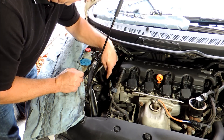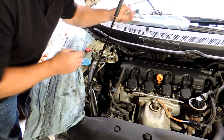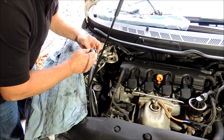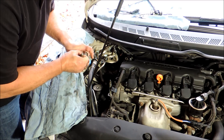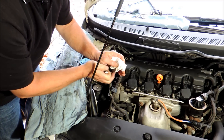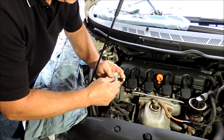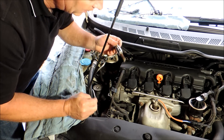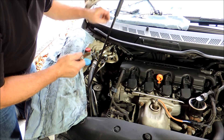Now in reverse order, I'm going to put that bolt back in the bottom — those are the two toughest ones to reach. Here's an old trick: try to get your hands down here and things are going to fall in. The bolt won't stay. So the best thing is to get a Kleenex, serviette, or napkin and just put it over the socket hole like that, get enough of it, push the bolt in, and get rid of the rest. It should hold it in place and you can drop them down. Clean the bolt off first — so you might need a little wire brush.